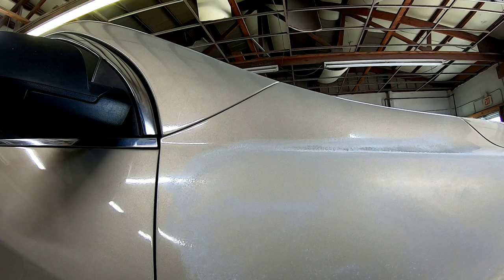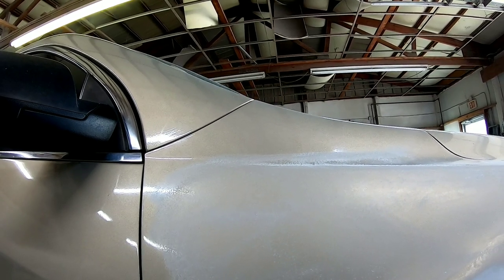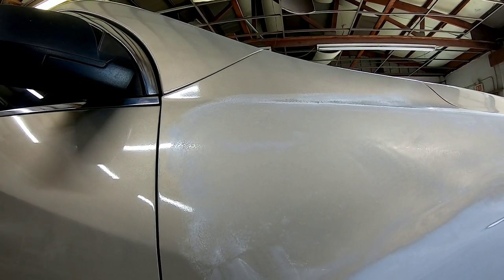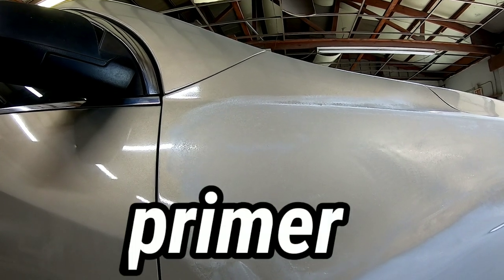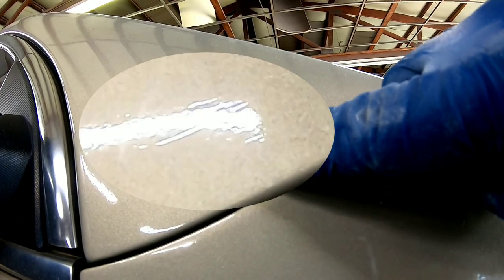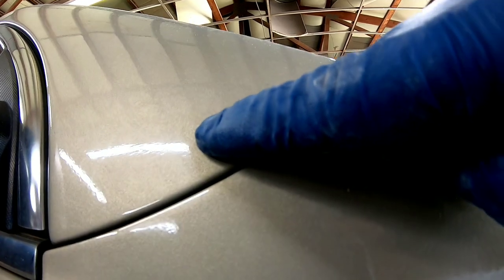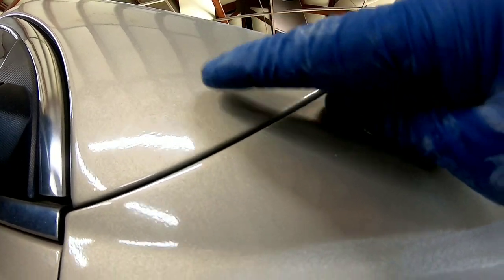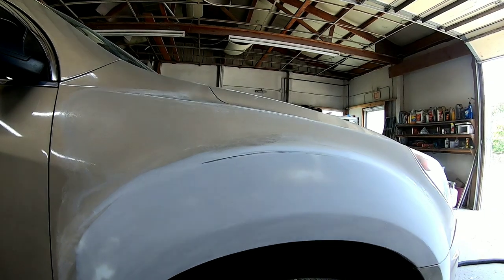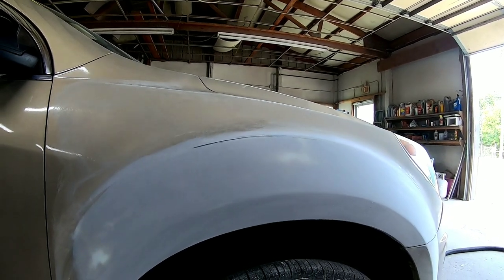I want to show you this — it's why you sand out the scratches in the body filler. You want to sand your body work with 320 grit sandpaper; don't use anything coarser than that before you prime. Don't leave any 180 or 80 grit scratches in your body filler or your paint — sand everything down to 320. This vehicle's been worked on before and they left scratches in their body work and primed over it, and it shows those scratches through the paint and clear coat. It pays to take extra time to make sure your body filler is blocked and sanded smooth and those coarse grit scratches are removed before primer.